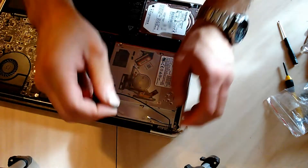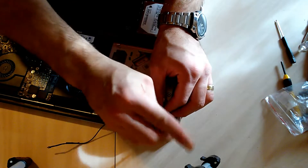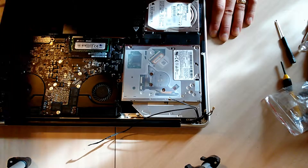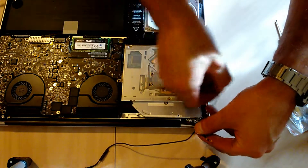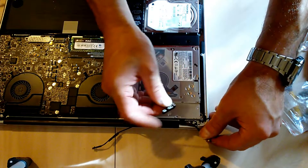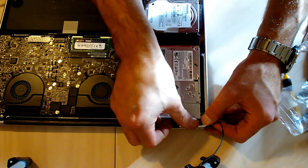Install the frame on the side where the DVD drive is. Make sure you move the cables out of the way but set them just where the frame would actually sit in place, tucked right over the cable as you see in the video. We're also going to connect the plastic panel where the Wi-Fi connectors connect into, right after this frame is screwed in.